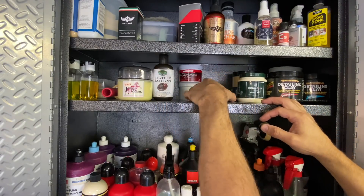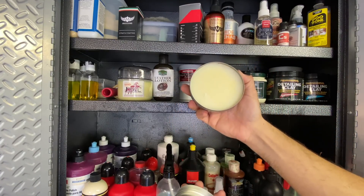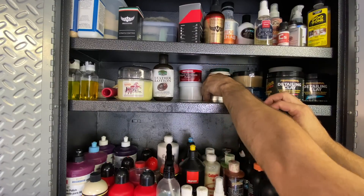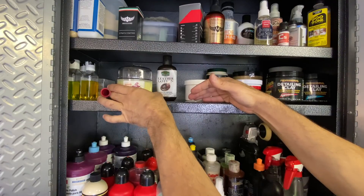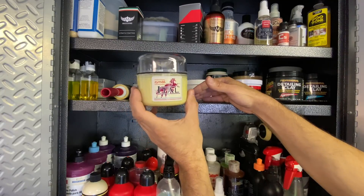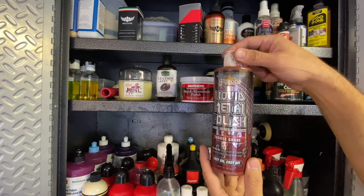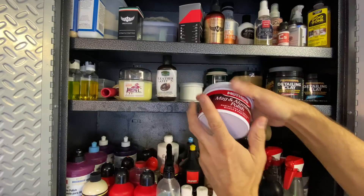Kamikaze Stance Rim Coat is a really good product - lesson learned: read the instructions. It says to leave it on the rim for 10-15 minutes, which is different from most ceramic coatings where you wipe immediately. With the Gyeon Rim I get consistent results and customers love it. The Kamikaze is phenomenal: leave it on, have good ambient temperature, not in the sun, not on a rainy day, do two coats. The chemistry is different from conventional ceramics - it's a real boutique brand from Japan.